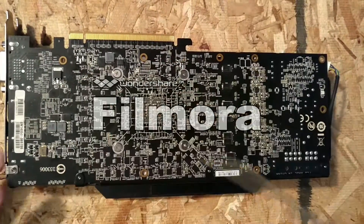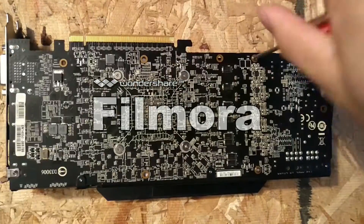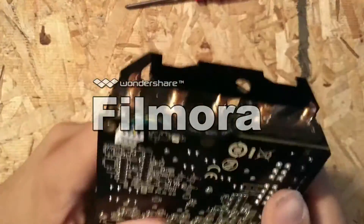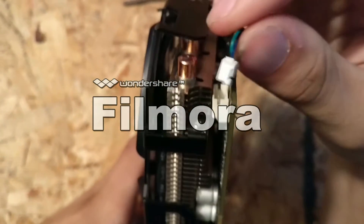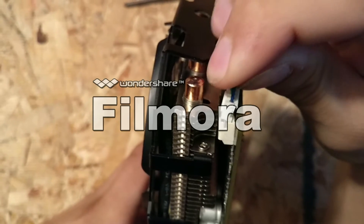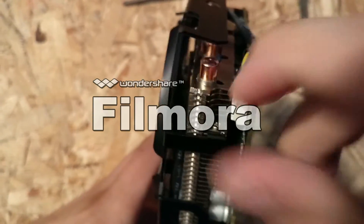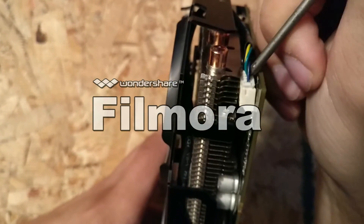Again, going in a cross pattern, you may have to hold your GPU or hold the heat sink onto the GPU because the screws aren't that long. Just put those six screws back in and make sure you plug the fan back in again — you don't want to kill your card. And you're all set. I just pushed the connector in with a screwdriver to help it out a little since I couldn't get my finger in there.